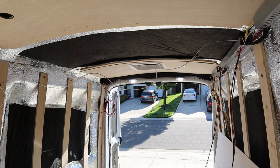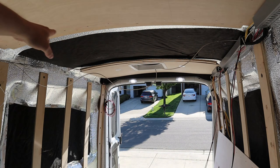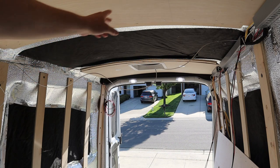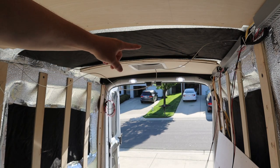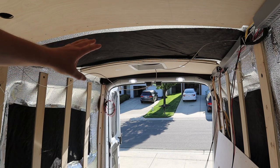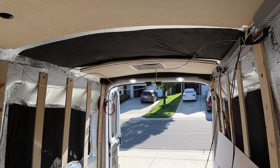Welcome back. Today I'm going to continue running power cables. In this section of panel I need to run a 12-volt DC line for the passenger side bed, a 12-volt DC for the driver side bed, and wires for two LED lights, plus dimmer switches — one for the bed lights and one for the kitchen lights. I'm going to put those right above the door so when you step in the van you can reach to your left and dim the lights.